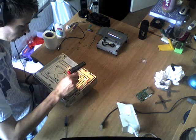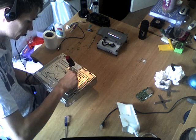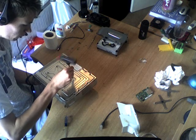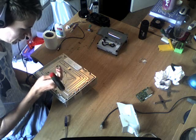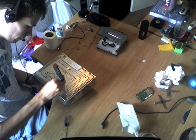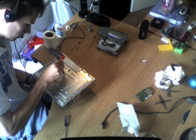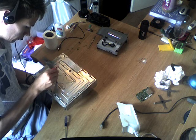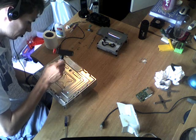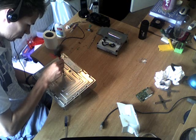You need to use the T8 screwdriver to screw them in, and this can be a pain in the arse if you haven't got a friend helping you do this, because they become magnetic and they like to glue themselves onto the screwdriver, as you can see. So make sure you give them a little twist when you're doing this. I'm just putting them on so that they've got a hold of the heat sinks.